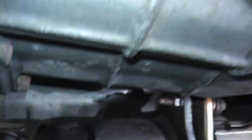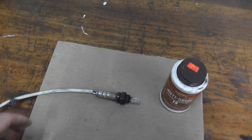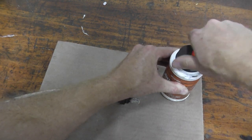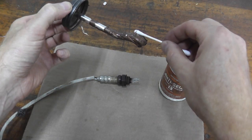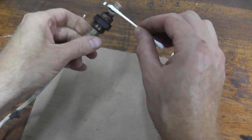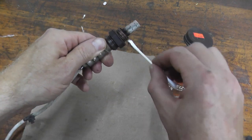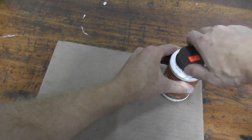These tests let you really pinpoint where the problem is. Before reinstalling the sensor, apply some anti-seize compound — make sure it's high temperature, copper formula. If you purchase a new sensor, it typically includes a small package of anti-seize. Use a Q-tip to apply it only on the threads, not on the element, as that can ruin the sensor. Don't go with an aftermarket brand — get the factory-equivalent: Denso, Bosch, or whatever the car came with.